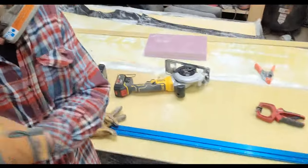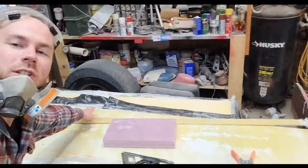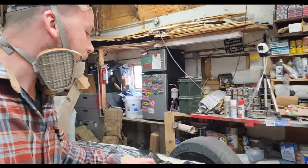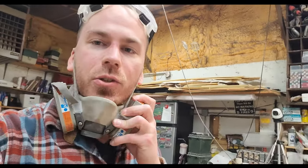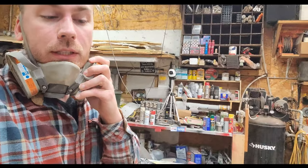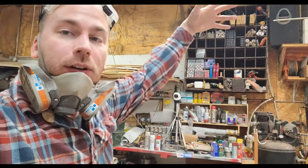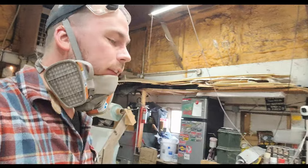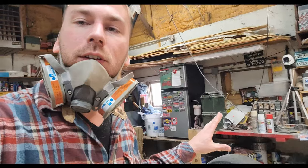So I am cutting. Take off my glove here. Some 2-inch strips. Making a hell of a mess, and these are gonna be, I guess you could call them, like a joist for the roof. They're also gonna be the channel that I put wires through, so for the solar, to go from outside on the roof, and to put my recessed lights in and everything. But my ceiling is gonna be 5 centimeters thick. Cool.